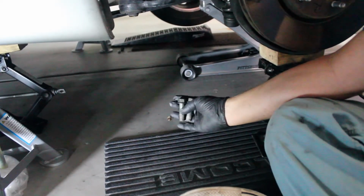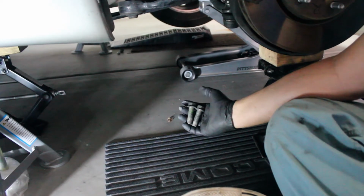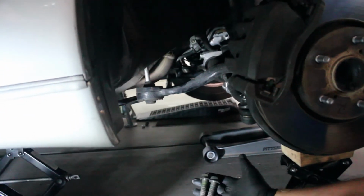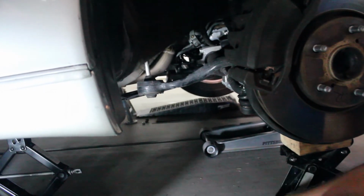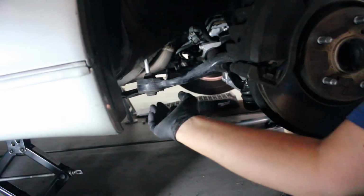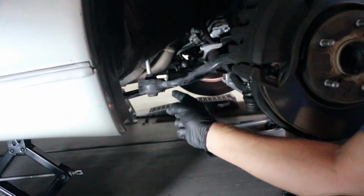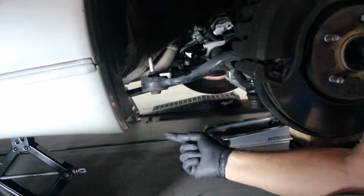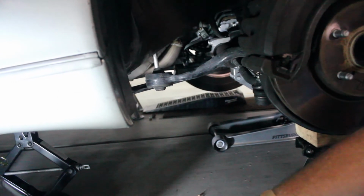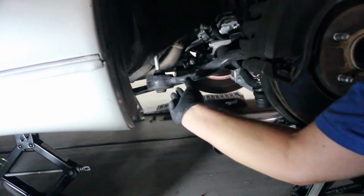Okay, got these two giant bolts loose from what I call the knuckle or the hub or whatever. They're underneath this part on the opposite end of here. And again, when those go back in, they're going to go at 122 foot-pounds. This piece now is loose, and I can go ahead and take it off. And by the way, when we put the nut on that, it's going to be 112 foot-pounds. And then the nuts and bolts that go into this plate that goes there, they're at around 43 foot-pounds of torque. So I should be able to easily pull this off now.